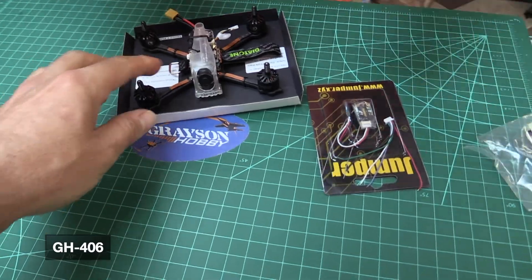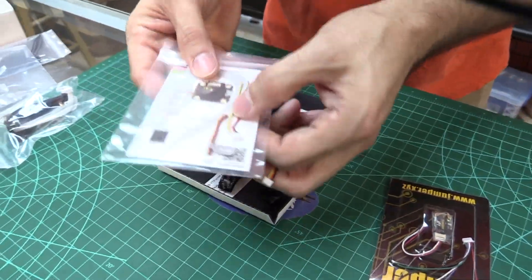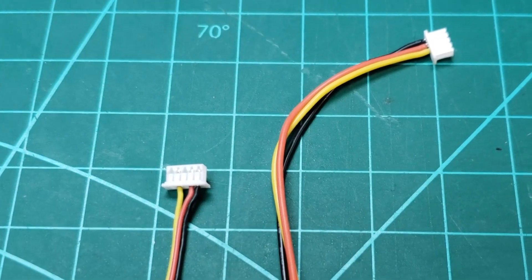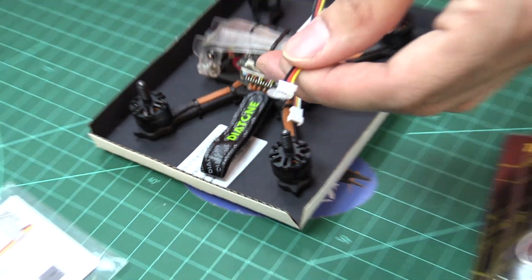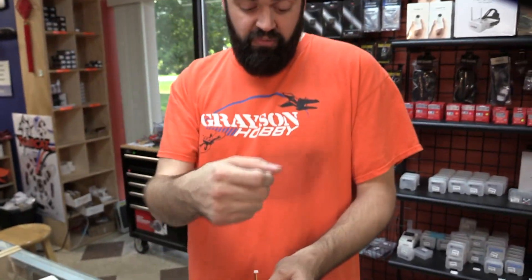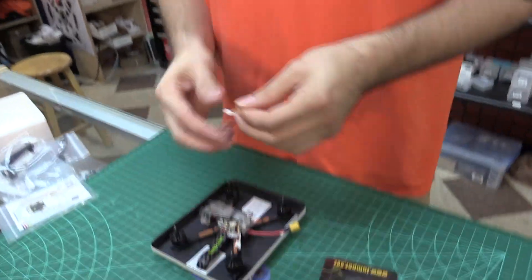This is just a traditional Diatone plug-and-play. If you compare it with the adapter, you look on the five-pin harness — it's black, red, space, yellow. This one's black, red, yellow. So if you're handy with an X-Acto knife, yes, you can lift the pin and move it — which you shouldn't have had to do. We've had several people say 'hey, can I get another harness because I broke it' or 'I cut it off.' If you don't want to risk it, spend a couple bucks and get the adapter. Call it a day.